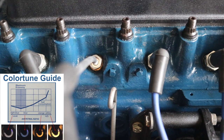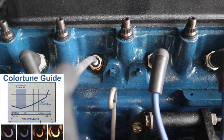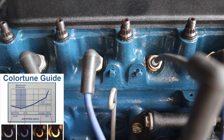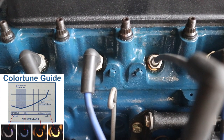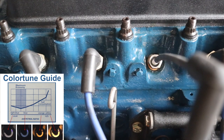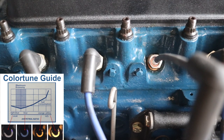So what you guys can see there is it's still running a little rich at idle. However, at the throttle load it's coming down and coming into the blue section. Let's run it up and you'll see. I'm a fan of the way that looks right now, so let's turn this back off and move to the next cylinder. Now we have that attached — let's start it back up and see what this one looks like. This side is looking rich as well, but not excessively rich. However, when it's under load it looks like we're getting a little yellow in the top end, which could be related to the needle, but it could also likely be related to the fuel mixture. So I'm going to lean it out just a little bit and we'll see how this looks.